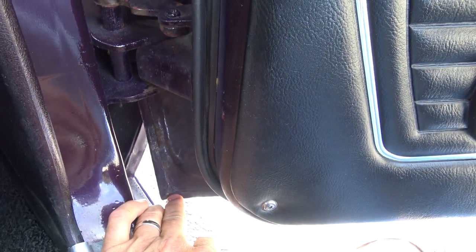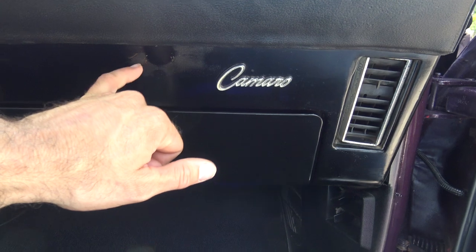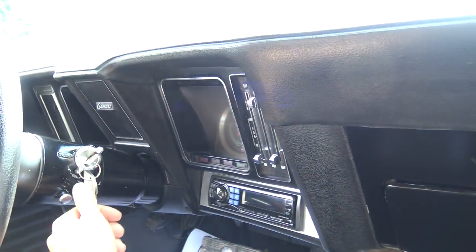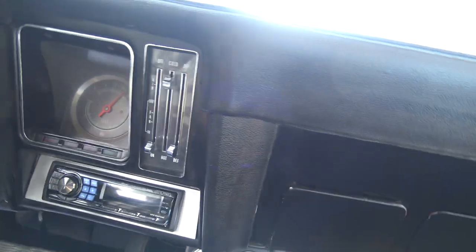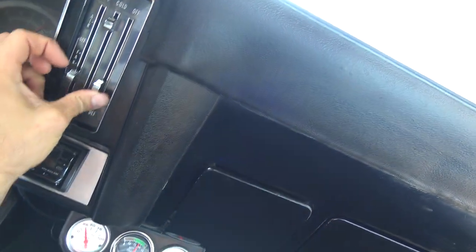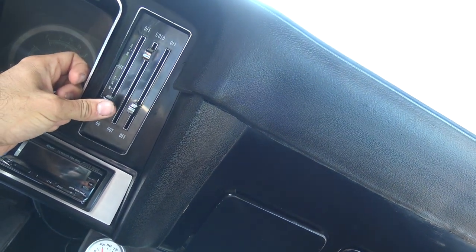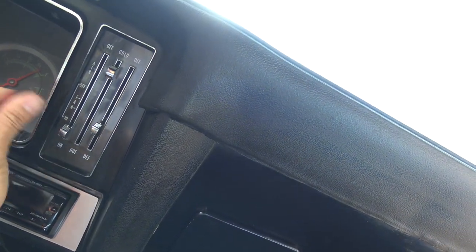Here's our corner of the door — it's nice and solid. If you look, it's never had any body filler. There's a little surface rust with the paint strip but no body filler or any work done in that inside corner. The dash itself has got a little paint issue — something got on the paint in this area on the dash — but the rest of the dash paint is good. From the keys rubbing, we have some little scratches on the steering column. The gas gauge works, speedometer works. Heater fan controls are all loose and free, but the heater fan is not working.